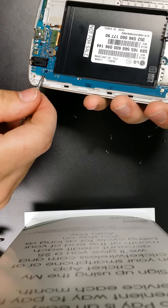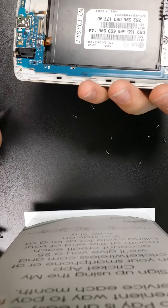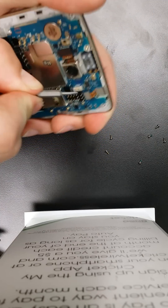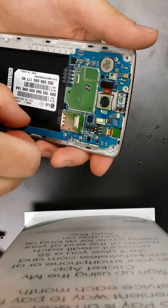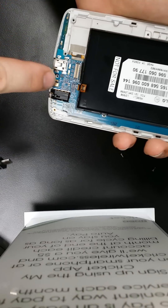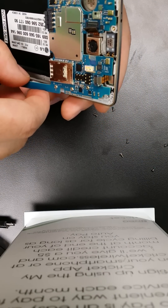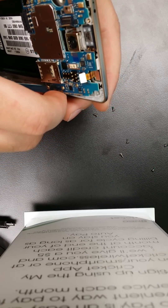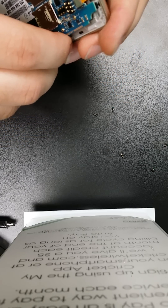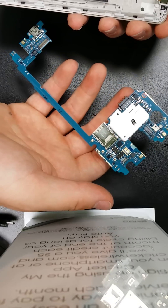How do we pry up this micro board? I believe it's like that. So I'm just going to take off the camera — not a lot of ribbon cables, only like the G2, which is a ribbon cable nightmare. One more up here. So that's 1, 2, 3 ribbon cables, and then I believe this board should just pop on out. Very simple. It's getting caught up on something. What's it stuck to? Simple. See that? Very nice.